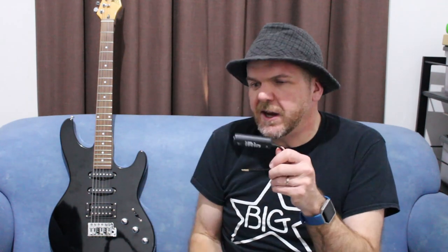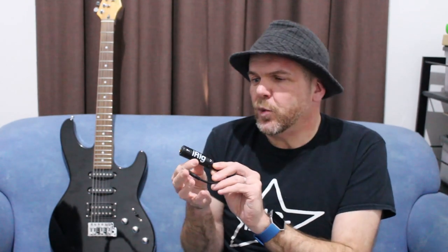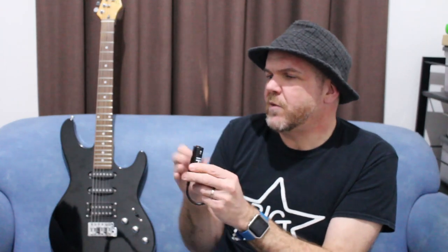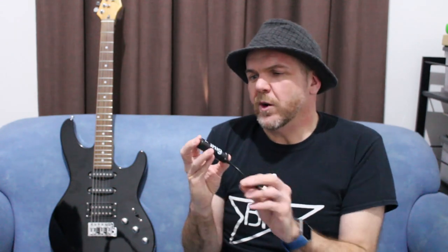The issue here is that we're only getting an analog signal going in through our 3.5mm jack. If you've got an iPhone 8 or iPhone X, that's going to be no good to you anyway. The sound quality from something like this isn't amazing because it is using an analog connector. The genuine iRig HD, which uses a lightning connector, is a lot better quality. Instead of plugging in via a 3.5mm jack, it has a lightning adapter at the other end — you can plug in your cable, plug in your headphones, and connect via lightning. If you want something with better quality but still portable, go with the iRig HD.